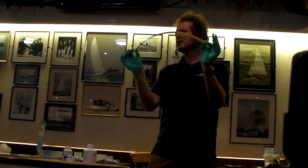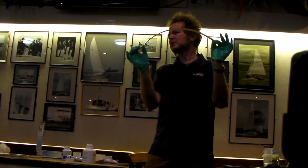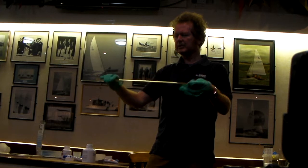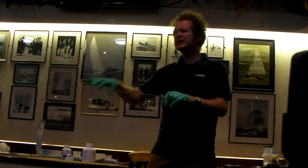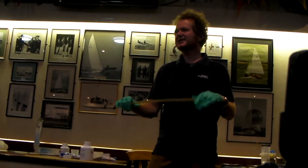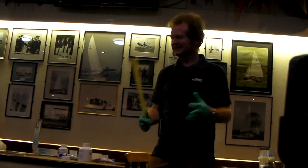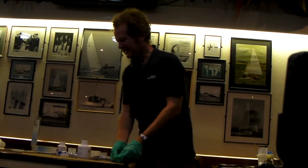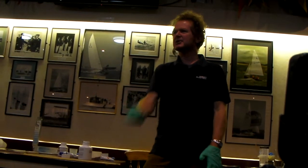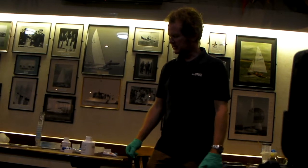That's not really a very good example - I was hoping it would break. I only did this this morning, so you can feel it's still a little bit soft and not fully cured. Making strips of things and bending and breaking them is a really good, simple way of testing. Any boat builder ought to be breaking things to test them rather than sending them to a laboratory.